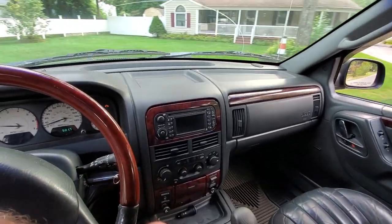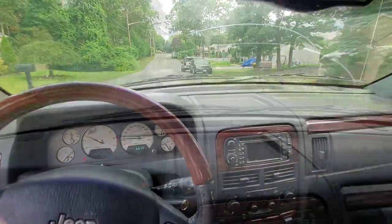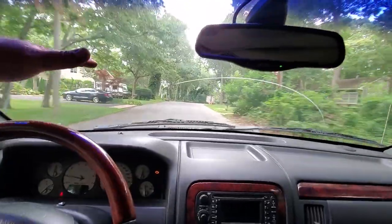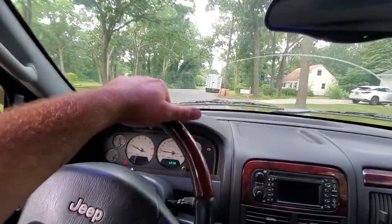Let's continue on with this test drive. Here's a good first test of how well you did your brakes - does it brake straight? Yes it does. Not pulling to the right or the left - nice, even braking. I am just gently driving around the neighborhood to break in these pads. These aren't ceramic pads or performance pads where you would need a proper brake-in procedure - I'm just going for a cruise and enjoying my nice new brakes. I got a nice firm brake pedal and I like it.